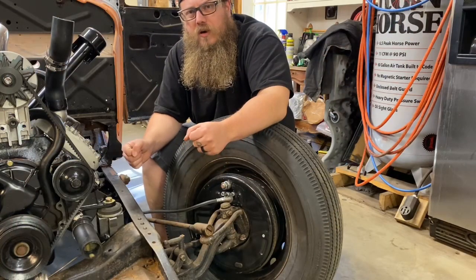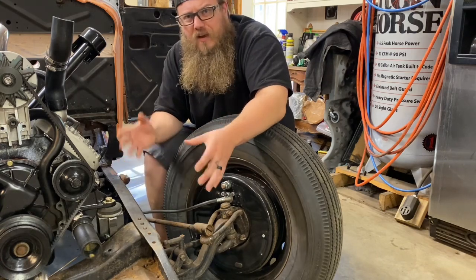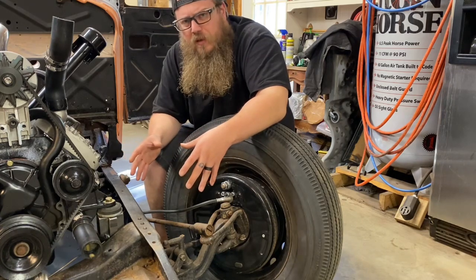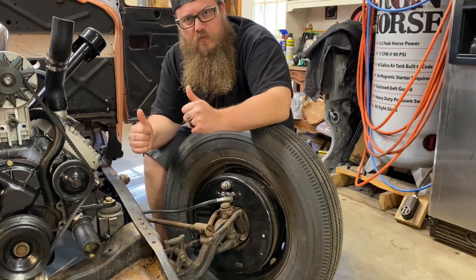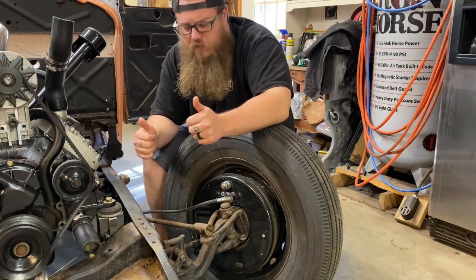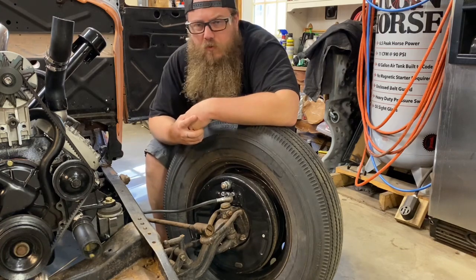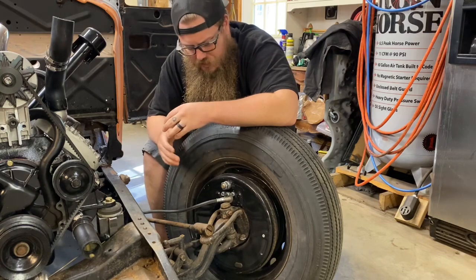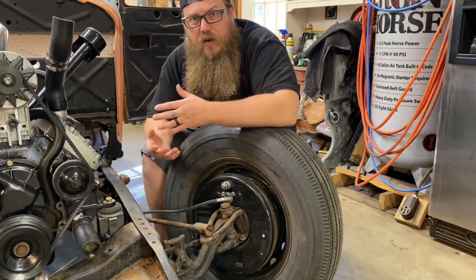It is just so great to bring your old hot rod into the 21st century with modern-style brakes, but everything looking traditional hot rod. I love hiding a little bit of it — when we put the floorboard on, all you'll see is the old-school pedals coming up from the floorboard, but we'll have a modern master cylinder underneath. The backing plates look the part — to me they look like F1 Ford pickup truck backing plates at first glance. So they look the part but they're way better than anything you could buy old-school.